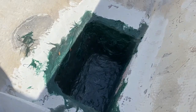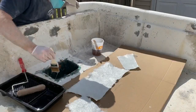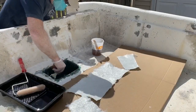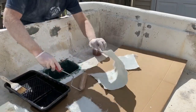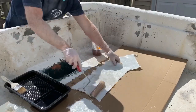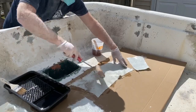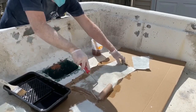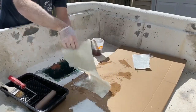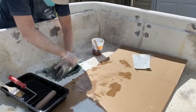This is the puttied glass box. The putty I used was Bondo — the fiberglass Bondo with fiberglass strands in it. I sanded that all smooth, and now I'm going to apply glass. I'm using biaxial, which is probably a little bit overkill — I just had biaxial left over from another project. Biaxial is a combination of the fiberglass mesh and fiberglass woven, so it's fairly thick. I pre-saturate the side that's going to get applied to the boat on a piece of cardboard.